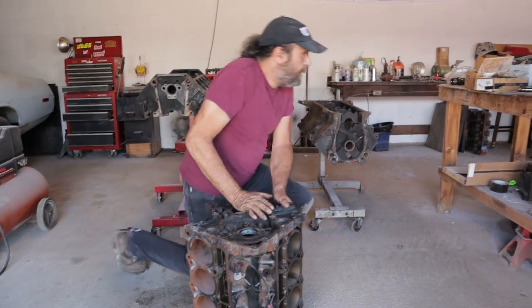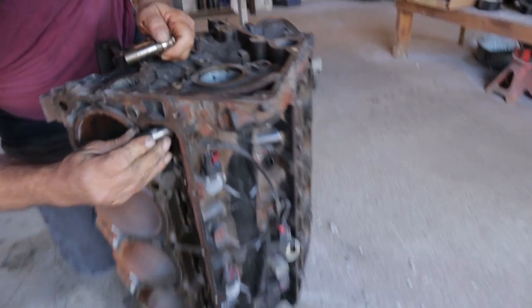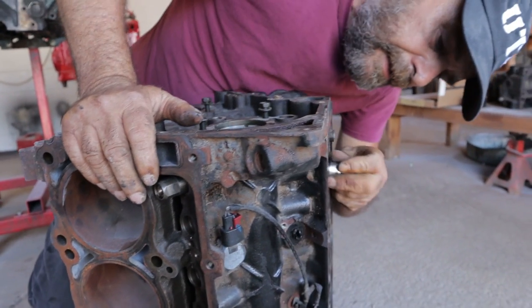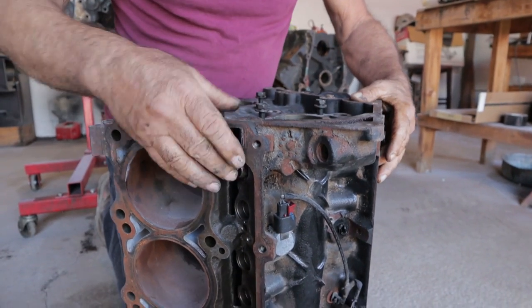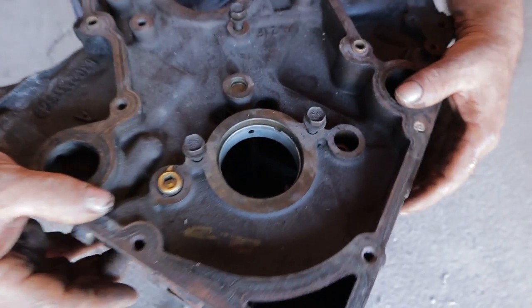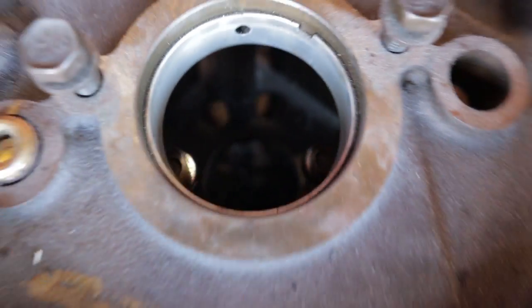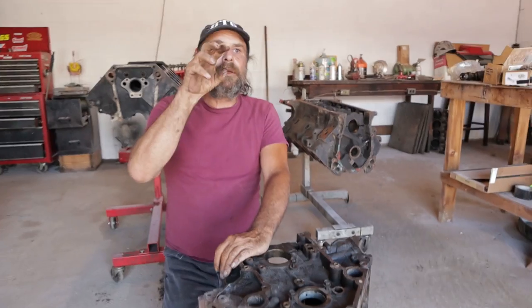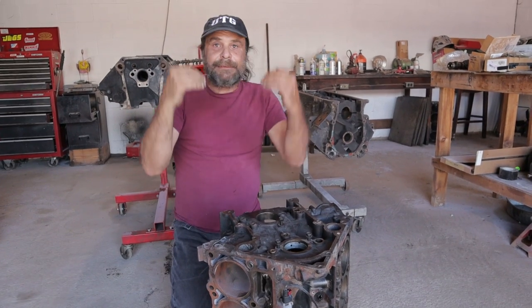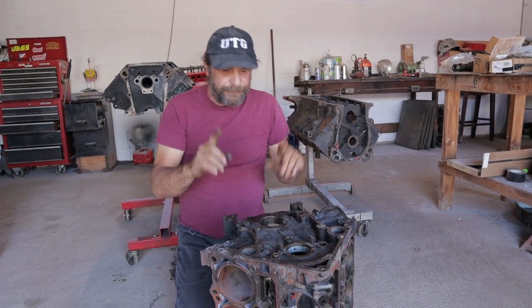the lifters, let me grab two of these lifters. Look in here. The lifters, if I push them into position here, the bottom of the lifters, look in here, the bottom of the lifters do not overhang the lobes. The bottom of the lifters are outboard of the lobes. So any oil that does get around between the lifter and the bore, when it does seep down, it's not being dripped onto the camshaft. It's actually being dripped down into the crankcase of the engine.